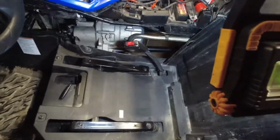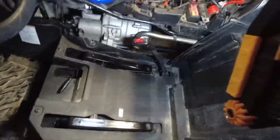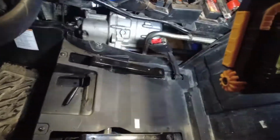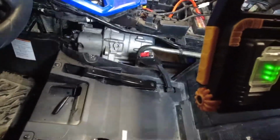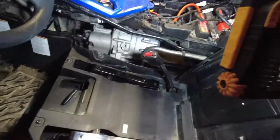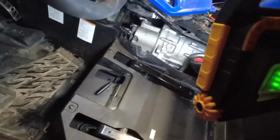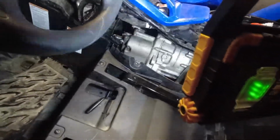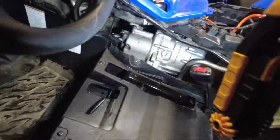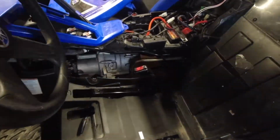So it's Tuesday tonight. Can't fire it up at 11 o'clock at night, it's too noisy. I'll fire it up Saturday morning, check the clutch works, bleed the clutch one more time because I'm going to let it sit now for a couple of days. If there's any air bubbles in it, they'll work their way up to the master cylinder. And I think, hopefully, I am done.